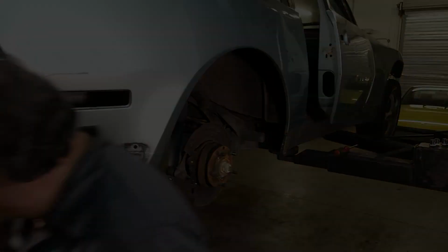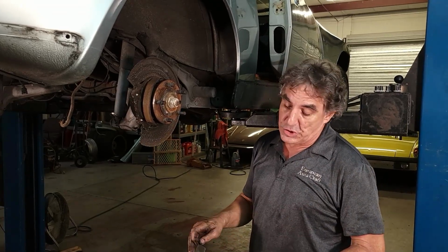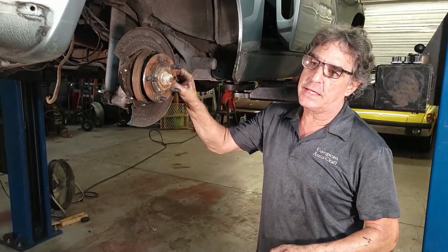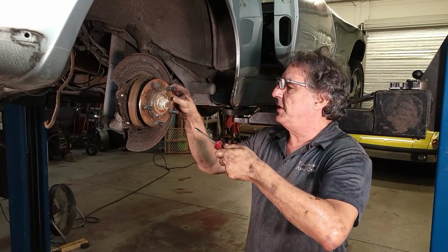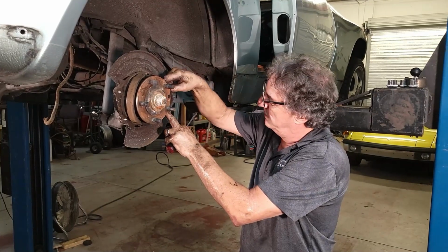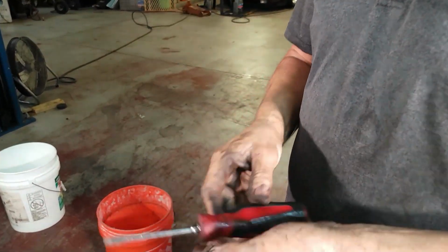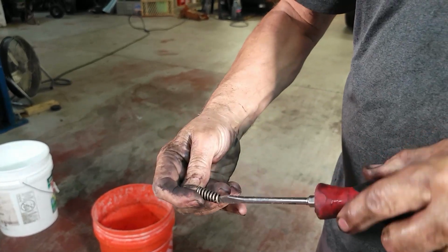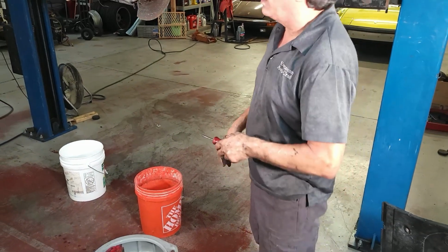I'm going to go back up. Okay, it did have to get a little bit wet. Screwdriver was in the trunk of my car. This is actually the right size 1/4-inch blade to get these springs off for the hold downs for the park brake shoes. Just push and twist and they come right out, usually. That's what holds your park brake shoe to the backing plate, and you can get the screwdriver right in there and just give it a push to compress it and twist, and the hook comes off the back. Pretty neat. But they break.